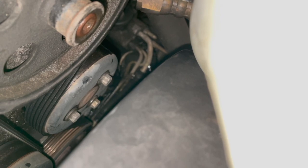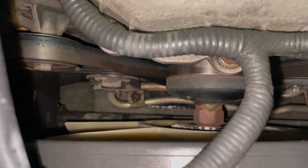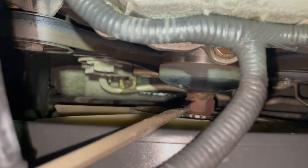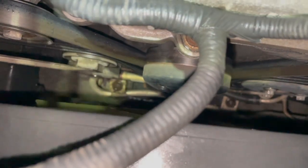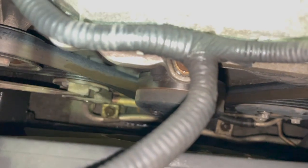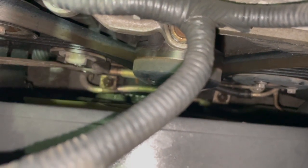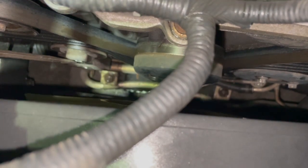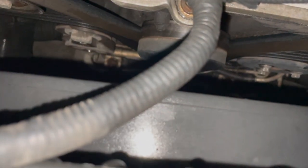To take the belt off there's a belt tensioner. Let me show you where it is. Going around to the front side — there's the fan right there. The belt tensioner is right here. It takes a three-eighths drive — you put the wrench in here and turn it counterclockwise, which pulls the pulley away from the belt and removes tension.